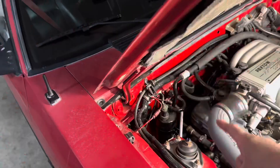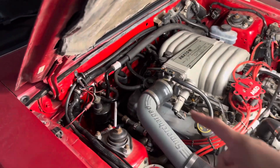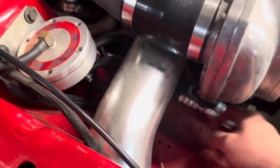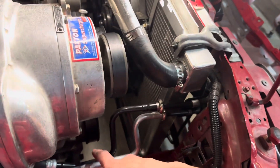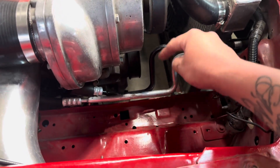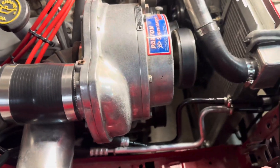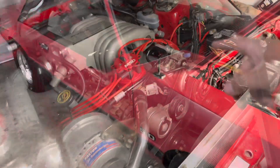If you're going from auto to five-speed, you're going to need pedals. Heater core lines and hoses will need to be replaced. The AC accumulator on the V8 wraps this way because the compressor is there; the four-cylinder accumulator comes straight here, so you have to replace the accumulator. The line that goes from the evaporator in the dash comes straight down and hooks up to the condenser — you can keep your factory four-cylinder condenser. You can even keep your four-cylinder low-side line, though it does a weird loop that takes up space and looks ugly, but it works. The high-side line goes to the AC compressor.